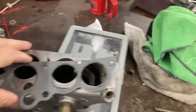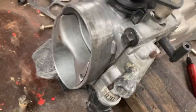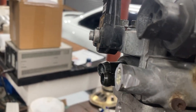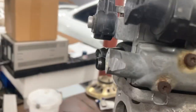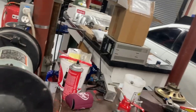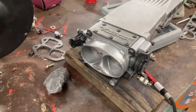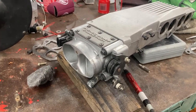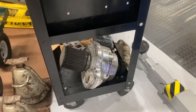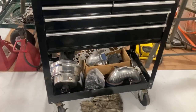Also on this car this time, I've completely stopped running water through the throttle body — I have for years. On the ones I've done before, I actually took a grinder and cut that down to where it doesn't stick out so far. You can do that — it doesn't hurt anything. I left some of it there just in case for whatever reason I wanted to throw a hose back on it one day, which I doubt I ever will. People say that's to keep ice from building up in them, and it is — on a stock car that you drive around a lot in wintertime, the heated throttle body is a wise thing. But on this hot rod, I don't think I really need it.